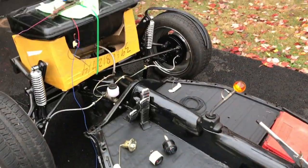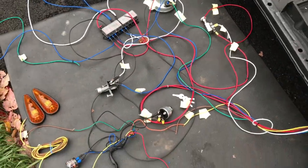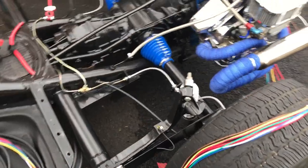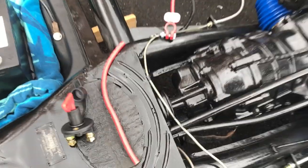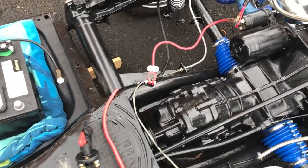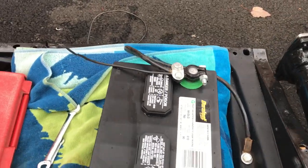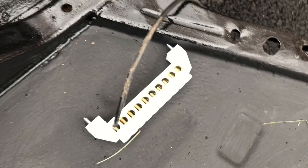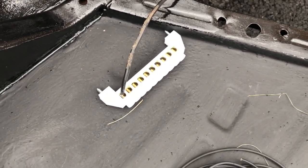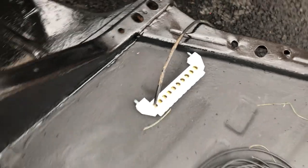Most of these wires are nicely already connected together. The front will be a mess, but once it's in the dashboard it will look a lot better. Before I get to the back, I've got this cutoff switch that I'm going to install in between the red power cable for the battery — just for extra safety when I park the car somewhere in public. The ground goes to the chassis, and I also ran an extra ground wire to the front to a ground terminal right here, which will be connected to the dash. Since I have wires on the fiberglass with no metal source close by, this will be a nice grounding access point.